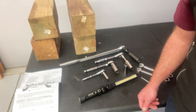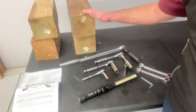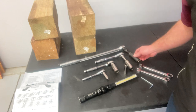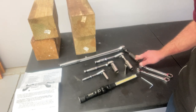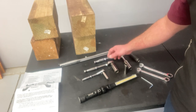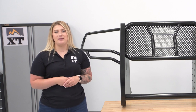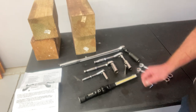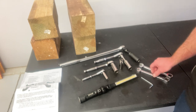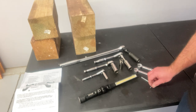The tools I used for the install — since I was doing everything by myself — I used two 6x6 wood blocks to help support it. Then I used a breaker bar with a 17-millimeter socket, half-inch drive, a 3/8 17-millimeter socket, a 3/8 with a 19-millimeter socket, a quarter-inch with a 10-millimeter socket, a 13-millimeter socket, a 13-millimeter wrench, a 14-millimeter wrench, a flashlight, and the Allen key that was supplied.